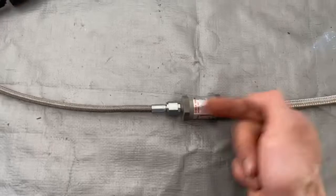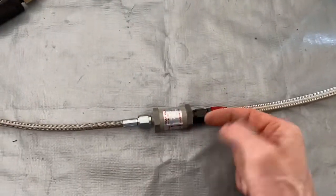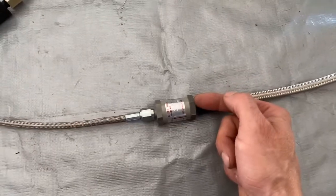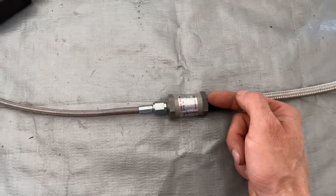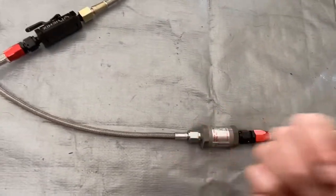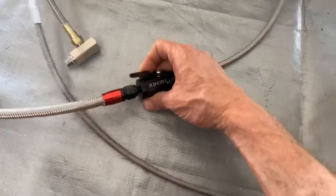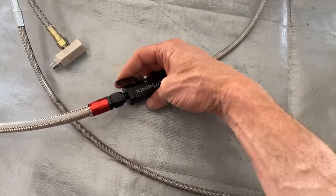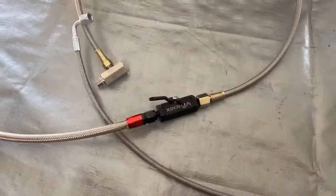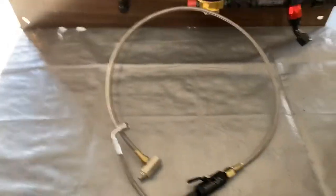This valve can handle about 600 PSI of back pressure in one direction, but it's only one PSI the other way. So when you turn the engine off, instead of that little residual pressure continuing to push oil into your turbo, it stops here until you turn the engine on and pressure builds enough to push through. It also gives a little back pressure to the oil pressure sensor. If I've got too much flow I can control it here — for the most part I think I'm going to want open flow with this turbo.